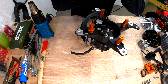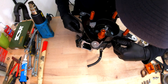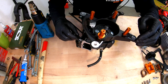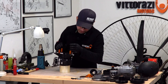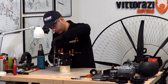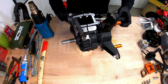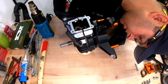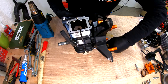Just take a few bolts that you can put here, here, and maybe here, no, here, another one here, and very, very easy. I'm not using a wrench, just by tightening by hand. And now, keeping the gap even, try to slide it together. You see, you can actually hear how the crankcase is going together, how the bearing is sliding over the crankshaft.